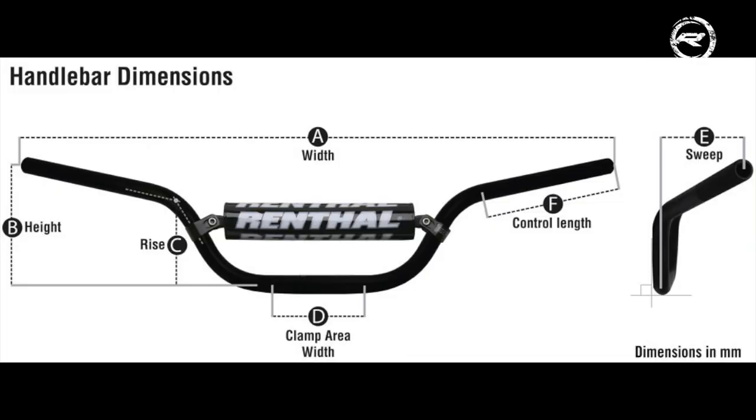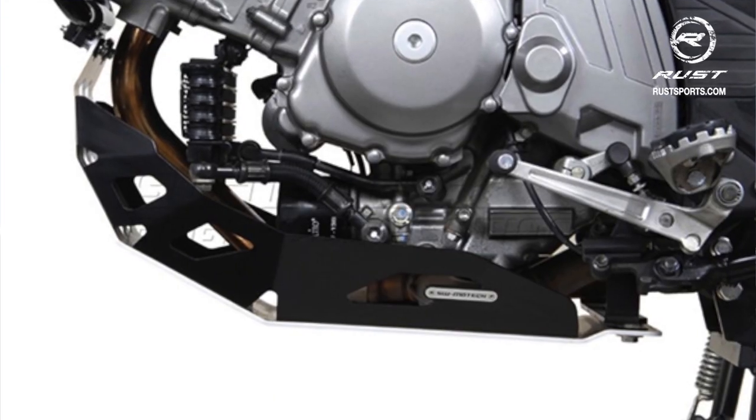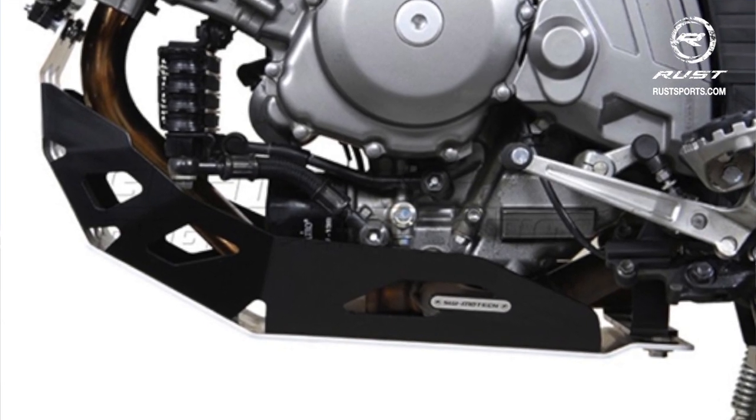There are also some modifications to the bike — as you can see there are some handlebars here. I want to change them up a little bit; probably straighter bars, as these ones have a slight cant backwards which is good for street work but too angled for off-road. I'll try for some straighter bars, and a slightly taller bend if I can, but I've got to be careful about cable length. Then a change of footrests to off-road type, and probably a bash plate for safety — there's an exhaust and oil filter you don't want to knock off.